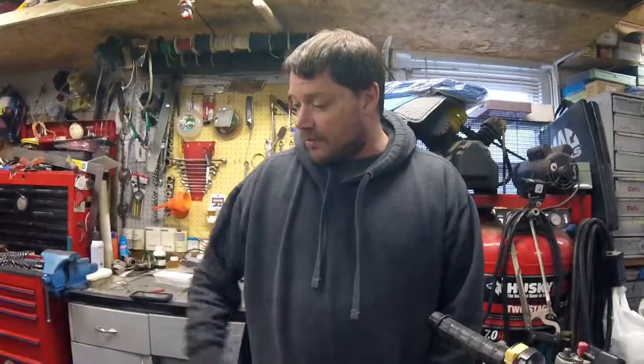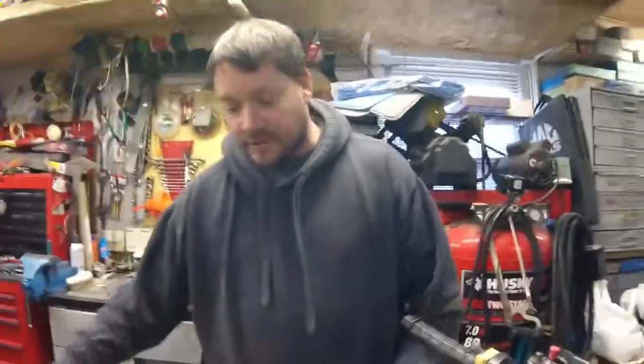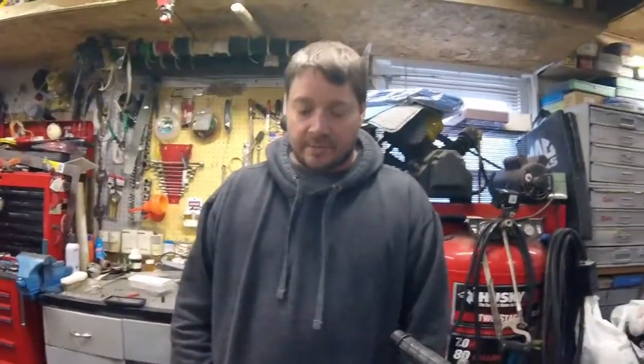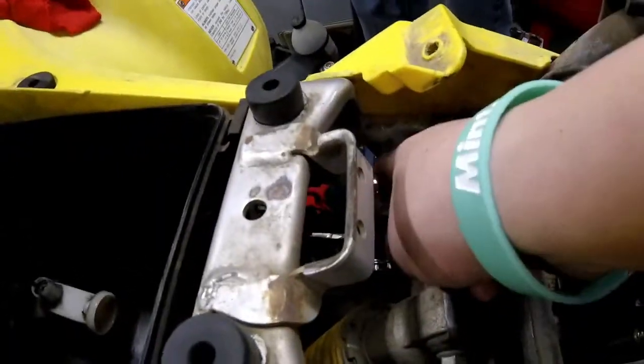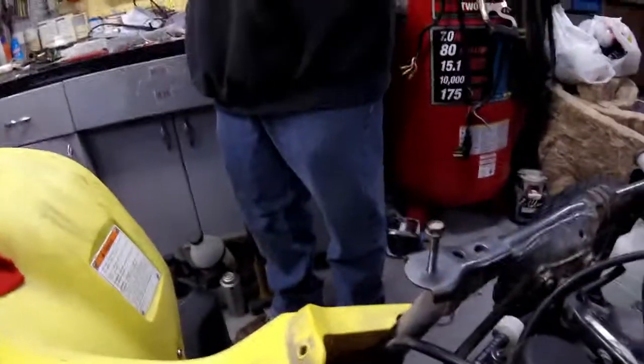Once again, it's going to be a pain in the butt. If I ever have to pull the carburetor out again, it's going to make it short. But what I'll do is just use a couple of butt connectors so I can just plug them in and go from there. Okay, so we just crimped these wires with some plug-ins on the end, and we connected them together from the carburetor to like the computer to send a signal to tell it that the throttle is open.